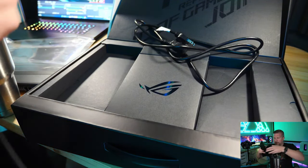It's far more likely that your VRMs or your fans are going to go out before your CPU is going to encounter any kinds of issues. Even 5-10 years down the line, I don't think you're going to run into any problems. Now, if you're going above 100 degrees Celsius, that's a problem. If you're hitting 100, you can also see thermal throttling, though. That becomes a bigger issue. Thermal throttling will reduce your performance and potentially cause 1% low stutters. So as long as you're not getting 1% low stutters, it's not awful.